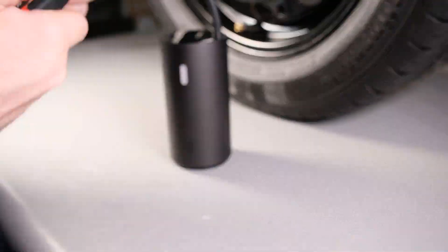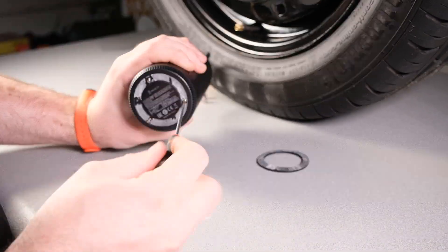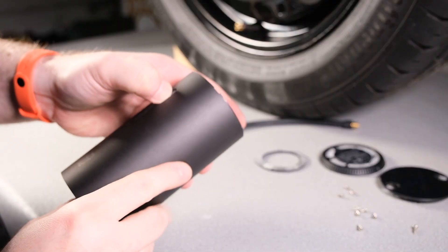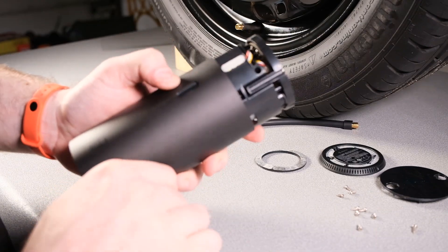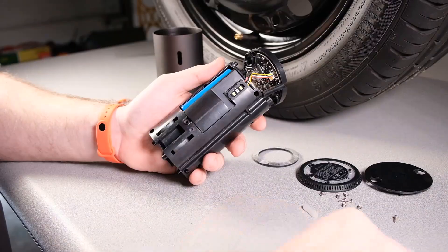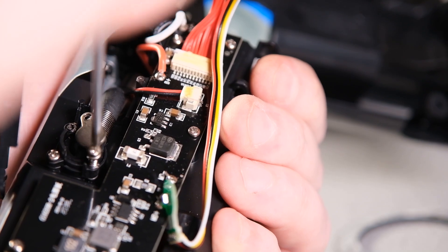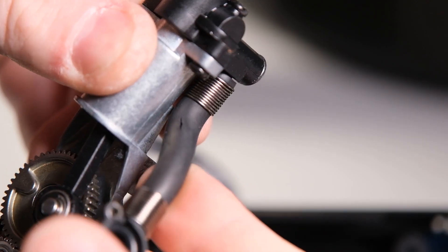In order to disassemble this device, we need first to remove the rubber ring from the base, exposing the three Phillips screws. Now the top can be pried open, exposing more screws. This looks like glass but it's actually glossy plastic. Next, the LED diffuser can be gently pressed inside, allowing us to carefully take out the whole assembly from the aluminum housing. Once this is out, we can remove four more screws keeping the two halves together. Under this metal cover we have the pressure sensor. I believe the problem is somewhere around here because the pressure reading was not working — and I'm pretty sure this is our problem: a crack in the hose leading to the pressure sensor.